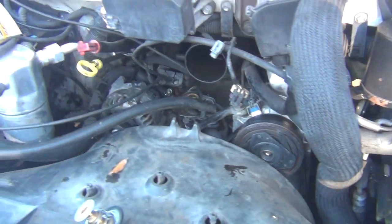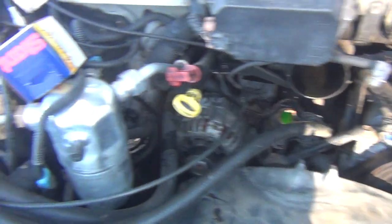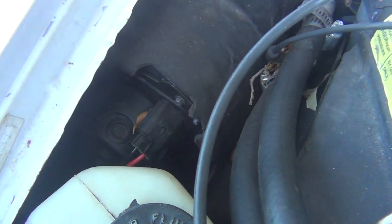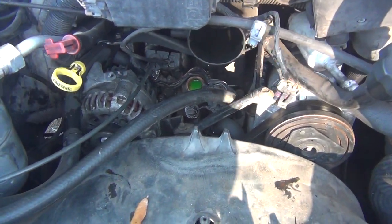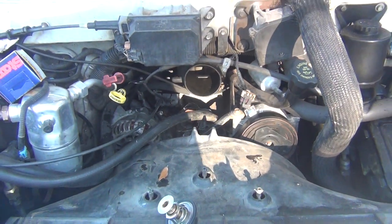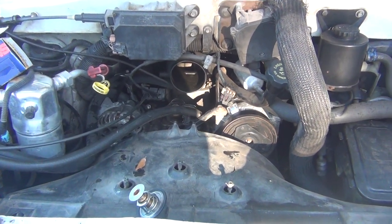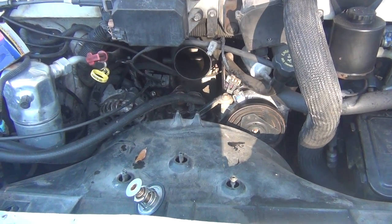When they did the AC they put in a brand new compressor, brand new dryer, and brand new blower. That blower blows out real good. The blower has a switch that goes from one to three positions but it was only staying in the first and second. I had to put a rheostat in there — now it blows in all three positions.